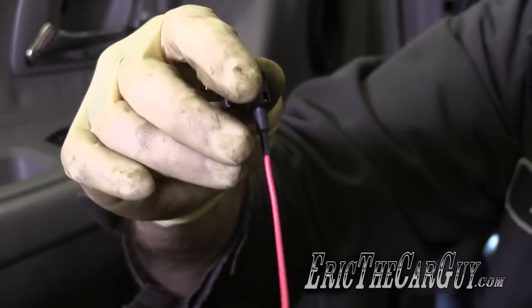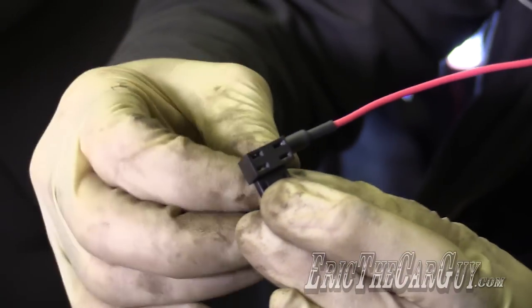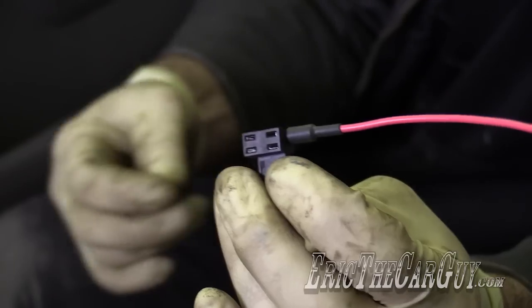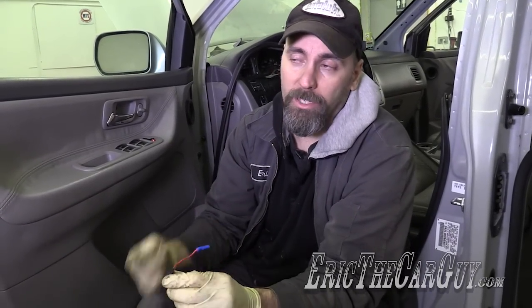I found a circuit inside the fuse box - the rear wiper - that's on its own fuse circuit and it's ignition hot. When I turn on the key, I have power to it; when I turn off the key, the power goes away. I don't want to leave power going to the DVD player all the time in case it gets left on and runs the battery down. The add-a-circuit has two fuse slots - one for the existing circuit, one for the new wire coming out. I'll put a 10 amp fuse in for the DVD player as well as the existing 10 amp for the rear wiper, then check that the rear wiper still works.